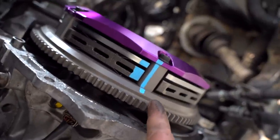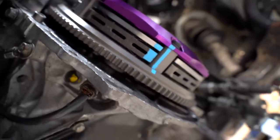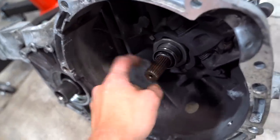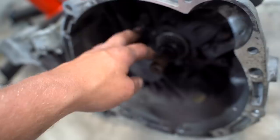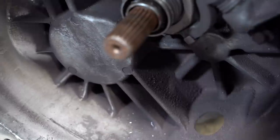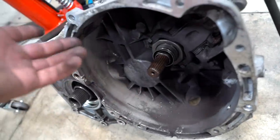The clutch is 100% installed. All of the blue markings still line up, which is what you want — I'm assuming it's because it was balanced that way. Now I've got to do some prep on the transmission: clean up the splines, because these splines go through the center of the clutch and now instead of one disc there's two. We're going to clean up the splines, lube them up, replace the throw-out bearing, and clean out all the old clutch particles so they don't contaminate the new clutch.